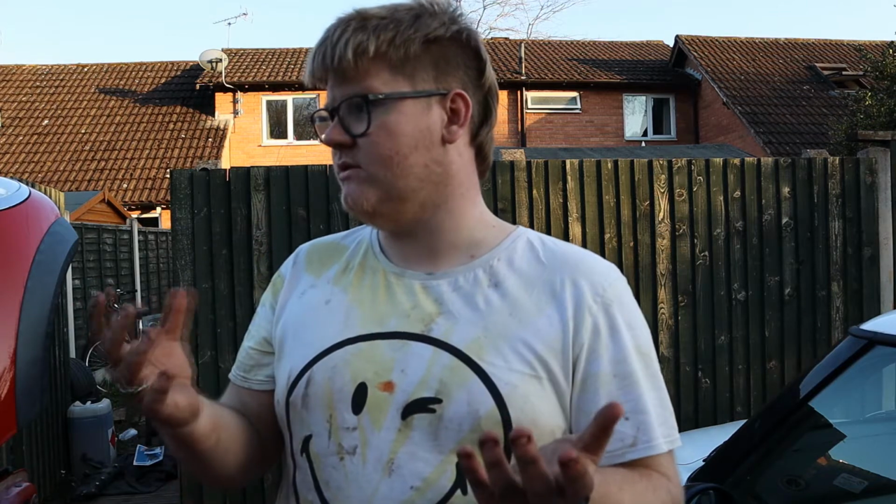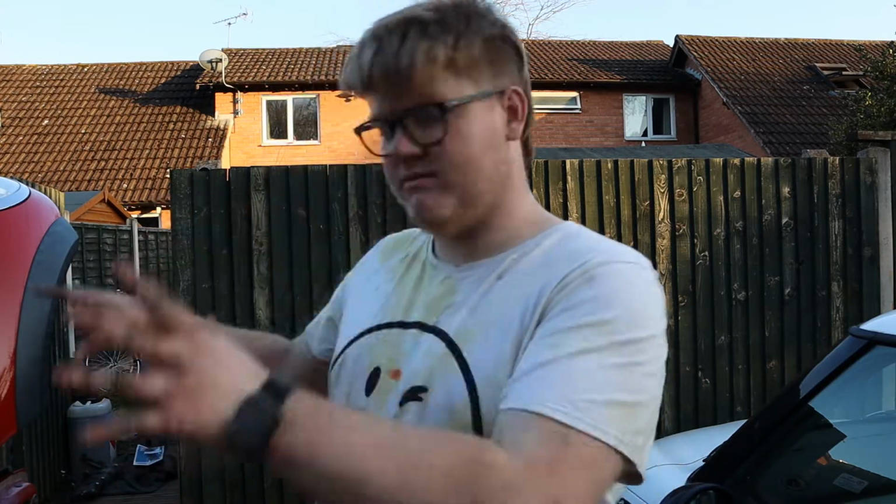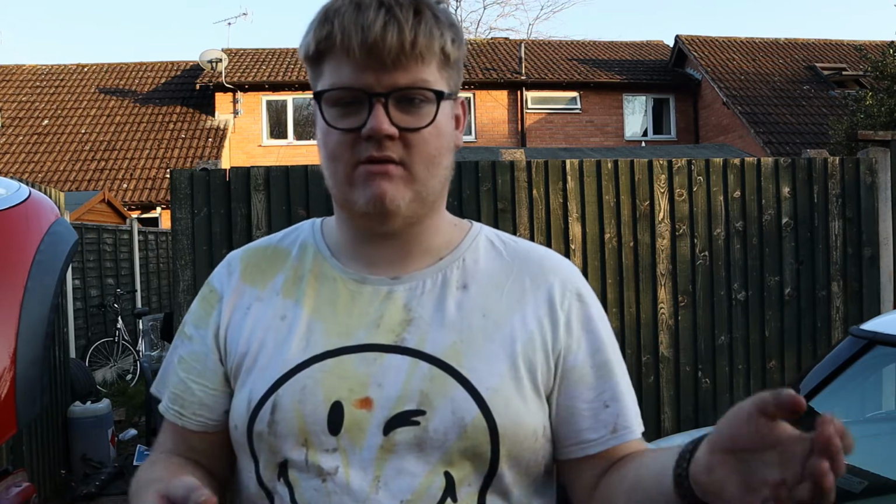When you turn the engine over now, you do get a slight chain clicking noise, but that's basically because the timing chain tensioner hasn't popped out because they rely on oil pressure. So that's the reason for that. So we were going to put everything back together and get it sorted so that we can run the car and stop the timing chain noise. However, I've just been putting the rocker cover bolts back in for the 3rd time now, and putting the bolt in at the back, and we heard a crack.